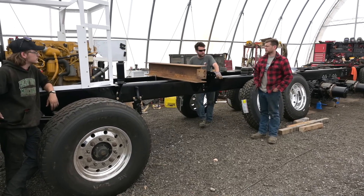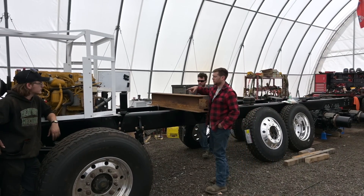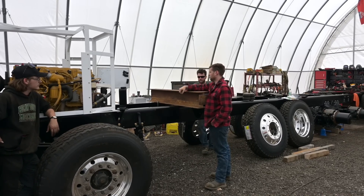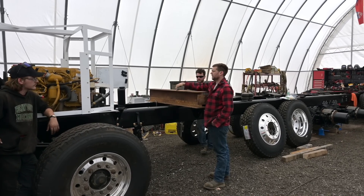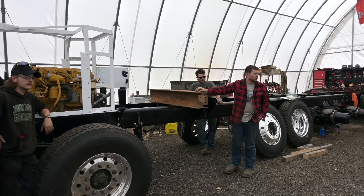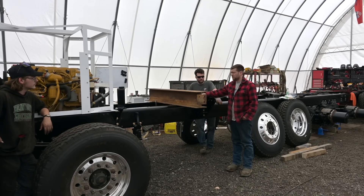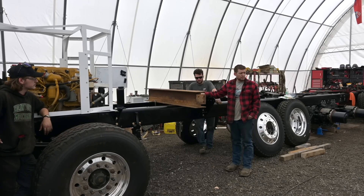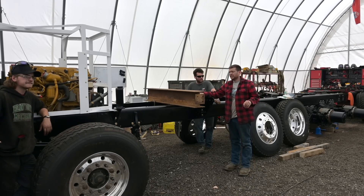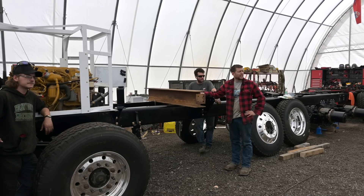So the plan here is we're going to get this cab on. We got the cab bolts ready, we'll put one cab bolt by each mount. Let's get the cab in the air, stick the bolts through the cab, and then we can use the bolts as a guide to position the cab. We'll put one person on each of the four corners, come into the back hole, pick it up via the sling that's up there. I had that rigged up.